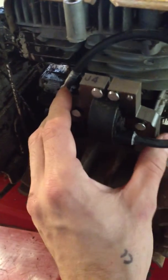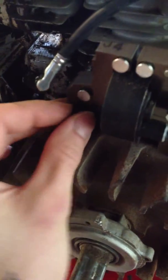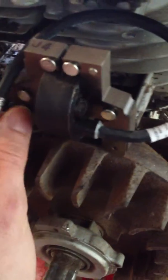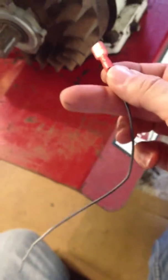So I'm going to put the armature or the magneto back in place, put my two bolts in, and then place a heavy piece of cardstock approximately the same thickness as a business card between the magneto and the flywheel. I've got a couple layers of sandpaper I'm just using as my thickness. This armature actually didn't come with the kill wire like my last one, so I just cannibalized the wire off my old unit and put a female connector on it. I'll just slide that on and it should function the way it's supposed to.